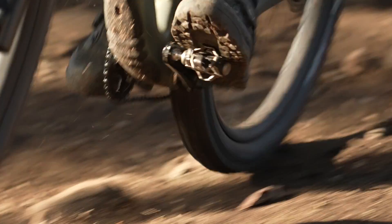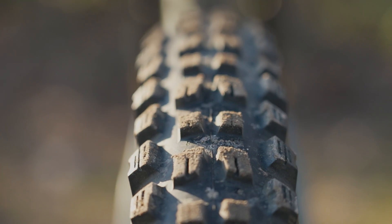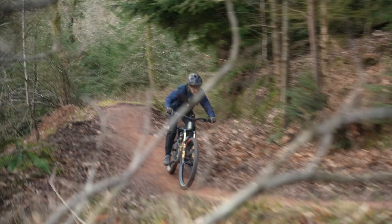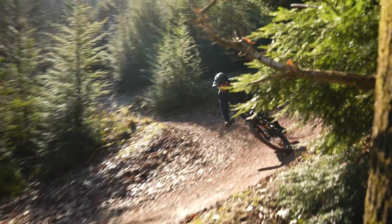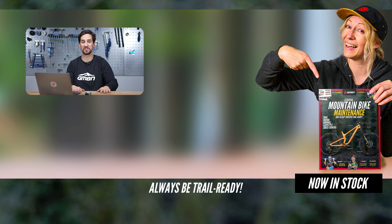In conclusion, the race tire is going to give you the most grip - that is evident. If you want the fastest time down the hill, the most grip, and the most predictable handling from your bike, race tires with a soft compound are brilliant. But there is a pretty sizable payoff in rolling resistance. If you want to get to the top of the hill or be quicker on flowy descents, then really soft compound tires probably aren't the best tire for you. It's horses for courses. I'll run the race tires if I'm racing enduro or downhill and need the best time coming downhill. The rest of the time, I'll stick to my Enduro or even Trail tires to get that good mix of durability and enough grip, taking the benefits of faster rolling for most riding.